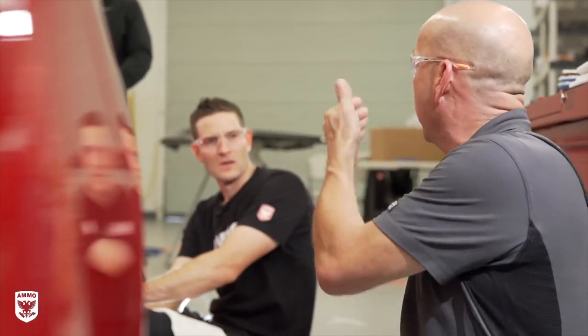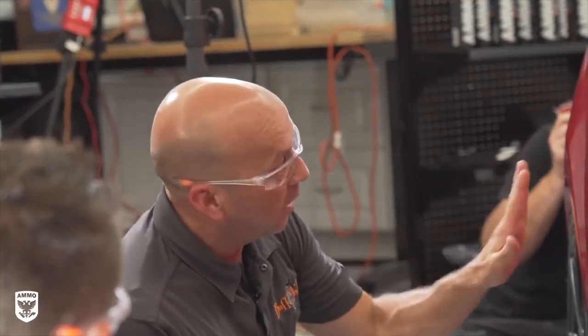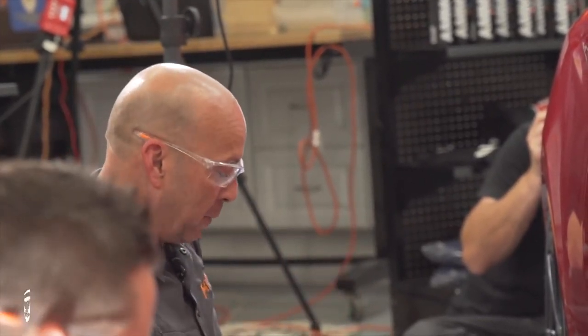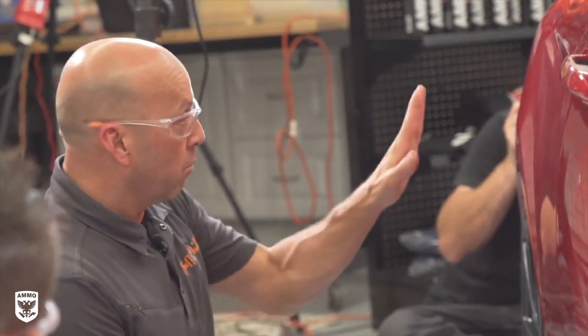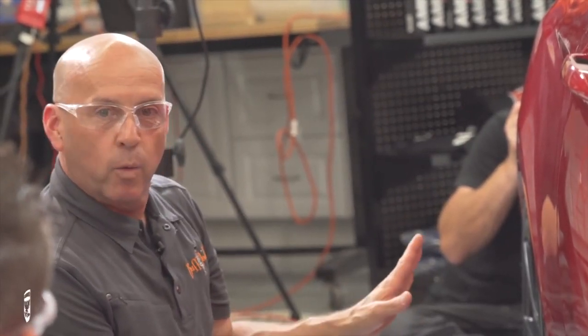It does sound reasonable. Would you sand with 3000 grit or 5000 grit and then lighten up on the last few passes? No. It's not an exact analogy, but it's similar. If I took this pad, primed it, blew out all the excess — there's still going to be some liquid with abrasive grains stuck to the microfiber or the foam. It's consistently applied. When I turn on the machine they're stuck in place, moving at the exact same rate as the machine, just like a sanding disc.